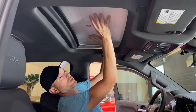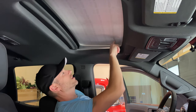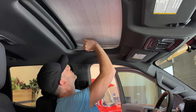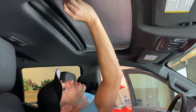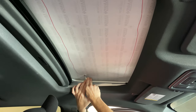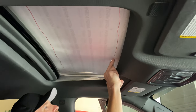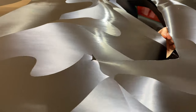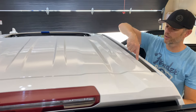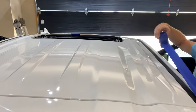As you can see, the vinyl is covering the open sunroof. The roof goes right to the back edge there — I want to make sure I'm at least a couple of inches in all the way around so I have enough material to wrap down. We're going to draw a line approximately two inches in as a guide, then let the cutting begin. Since we want the vinyl to stick to the middle area in case I need to do any shifting, we're just going to frame the part we're wrapping and put some tape around it.